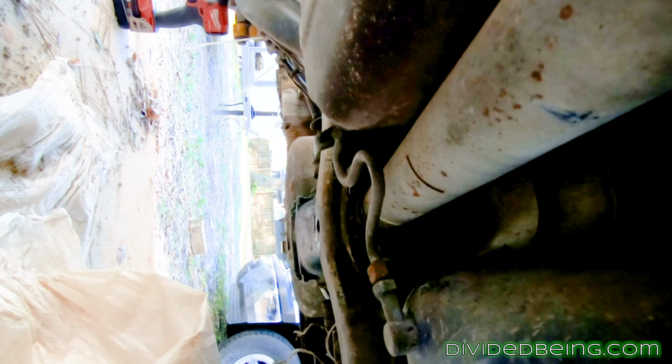So anyways, this piece coming off of the differential there is going to stay. I've got to take the rear subframe off for bushing upgrades, and I've got to take the differential off anyways for welding the differential for little drift action there. And I still haven't seen what transmission this is. It's some kind of Getrag 240. It's a Getrag 240.